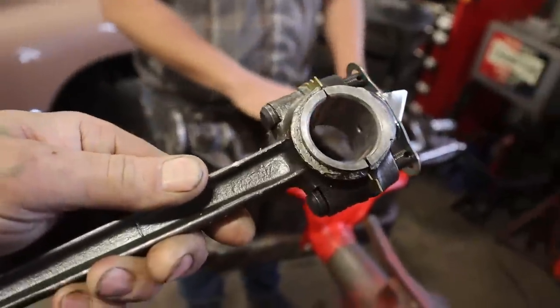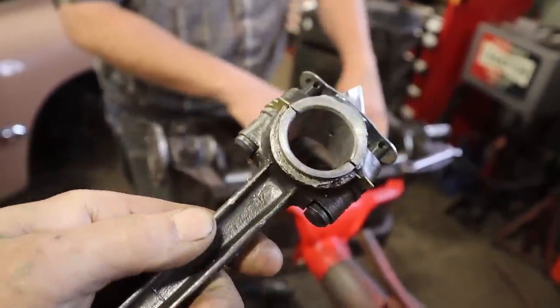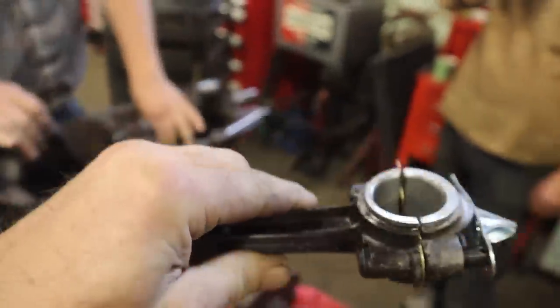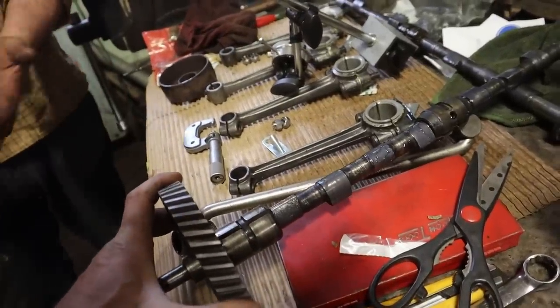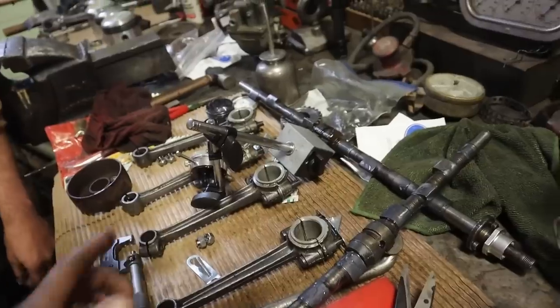I should probably see what I'm actually filming. Look at that. We machined them on that antique 1920s machinery. That looks fantastic. They're all plastic gauge, everything's 1.5 thou, like it should. Some high performance camshaft action. The profile of these is just unbelievable. Flathead profile, right? Just up and down. And what's this guy that's here?